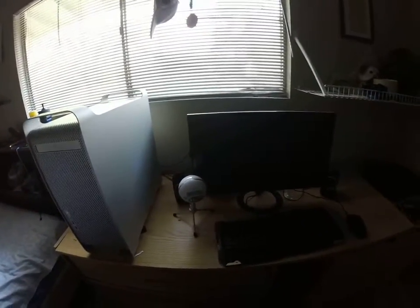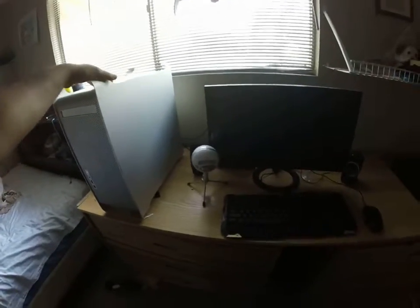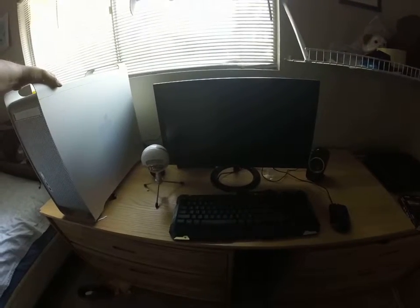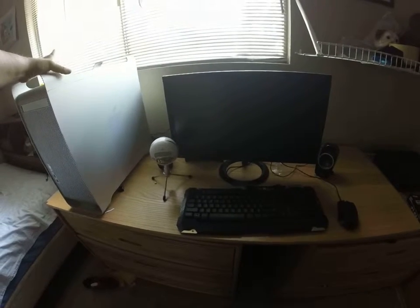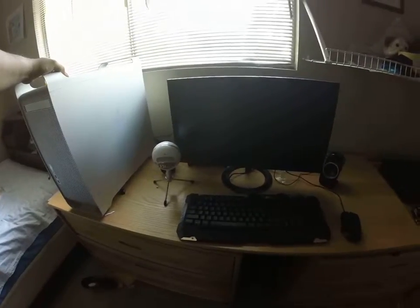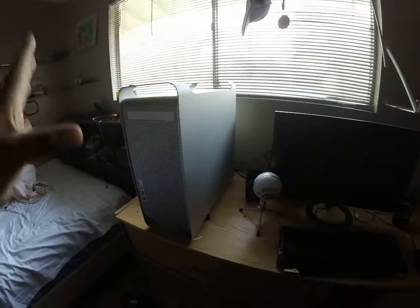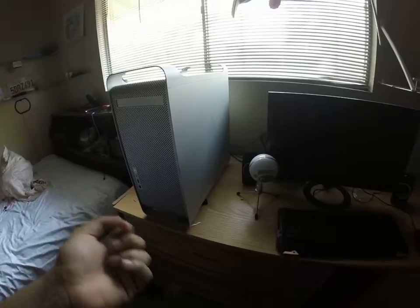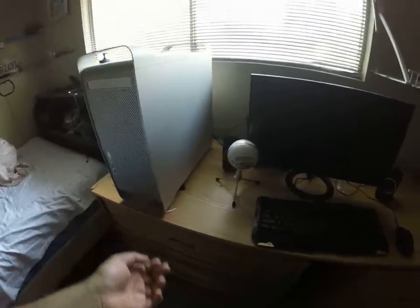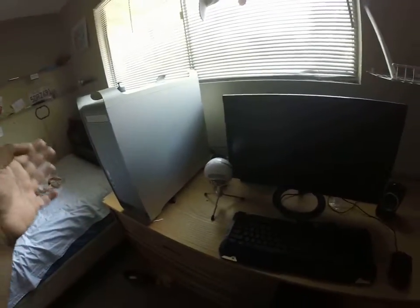About a week ago I posted a video of me trying to get this Power Mac G5 computer running, and I encountered a problem: it would boot up sometimes but not all the time. Sometimes it would go straight through with no problem, and other times it would go straight to a flashing grey screen or a grey screen with a flashing folder that had a question mark. That flashing grey screen or question mark screen indicated that there was a problem with the hard drive or something along the lines that connected the hard drive to the computer.